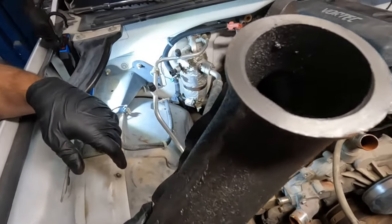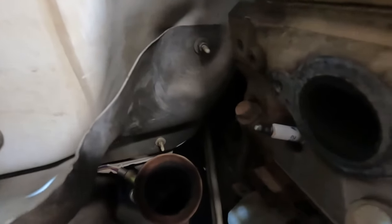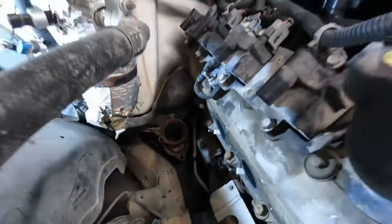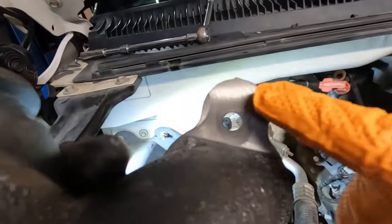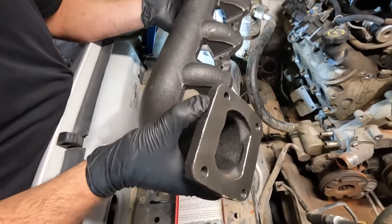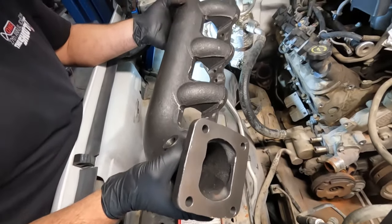Some of the first things we notice is this straight up just hits the plug back here that would normally house the coolant temp sensor on the driver's side cylinder head. Yep. So we're going to have to notch this area back here. It looked like it was pretty flat. We're going to put a straight edge across it just to make sure, and then maybe take a little bit of material out of the horrendous manifold side ports.